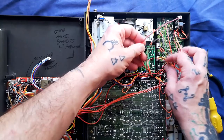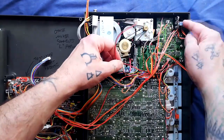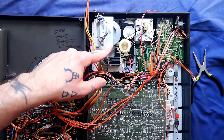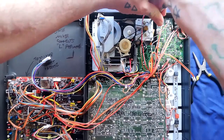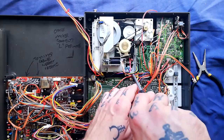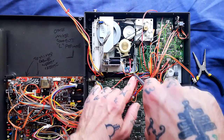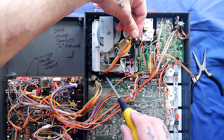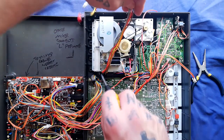Last of all we've got a little brown and red cable going up to a two-pin header by the power switch. Now we can unscrew the cassette player from the plastic case. The top right corner screw needs to be removed, then one diagonally down to the right from this large solenoid. There's also a screw down here just where these magnetic head cables emerge.